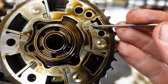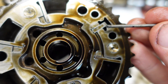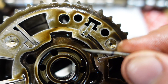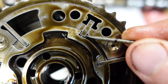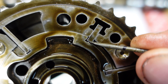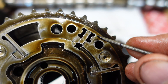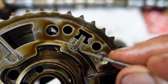Here you can see the locking mechanism. It's a bit different than in the older VANOS systems where you had the pin that dropped. Here you can see that you have this plate, and there's also a spring inside. This is now locked in the initial position, and when oil pressure is applied, it goes through this channel here and then builds pressure underneath this plate. The oil lifts it up and then it unlocks so the VANOS can rotate. Let's see if this is stuck — yeah, it's stuck. Ideally the spring should lock it back and it doesn't, so this VANOS unit is definitely binding.